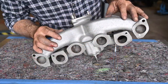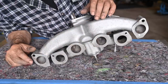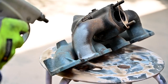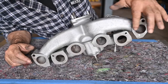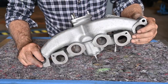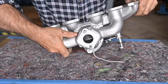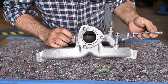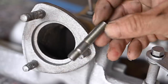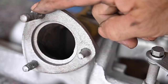The intake and exhaust manifold are bolted together. I had it shot blasted with Garnet 360 inside and also on the outside, and I already painted it with a heat resistant paint. Overall it looks fairly good, however there is a bit of an issue here — the studs are broken off or badly damaged. I have no replacement studs, so they will have to be removed first.